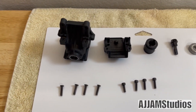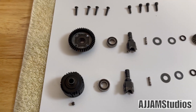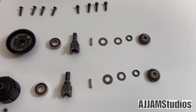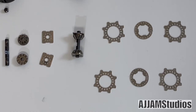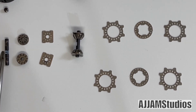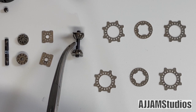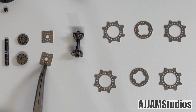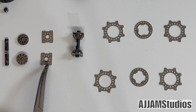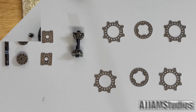Here are your parts: your housing assembly, your differential assembly on both sides with all the components, your planetary setup, and your LSD discs. Looking at the planetary system, you've got a rod — notice the flat spot, the notch in it. Each one has one, and that helps to interlock things. See the perforations in the shims? That is what controls the oil — it adds resistance. This is another part of the LSD system.